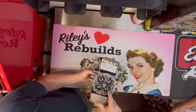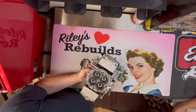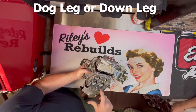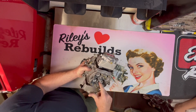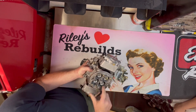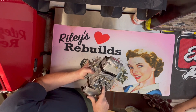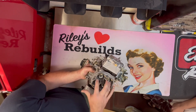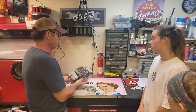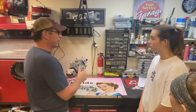This is the most important part to me personally — these are called annular boosters. The annular booster takes what used to be a single tube called a dog leg, where all your fuel came out. Now it comes out in 12 little holes all the way around the charge, so it's already atomized and it burns so much better. People who have switched from a dog leg to an annular booster will never go back. This is something very trick that you only get in race carburetors. This carburetor is honestly probably better than the one I have on my drag truck.